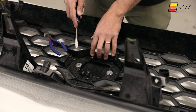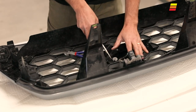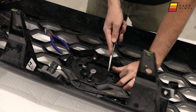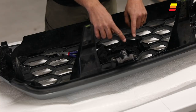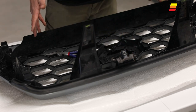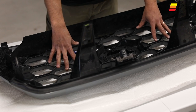For the Tacoma Pro grille you're going to need these two large inserting washers — clip those off and we'll be using them for the install. Last step is the outer ring: there are eight small black screws to remove off the top, bottom, and sides, and then there are a bunch of tabs along the same ring that we need to compress and push through to release the main grille out of the shroud.